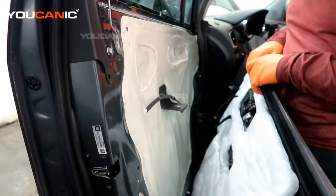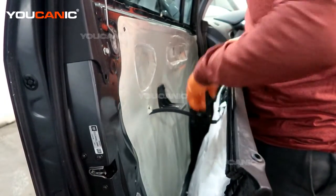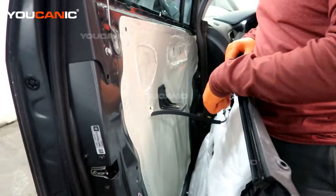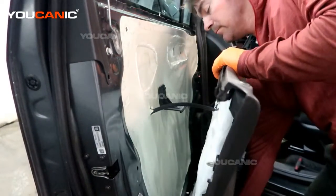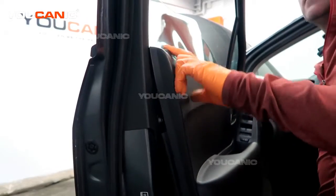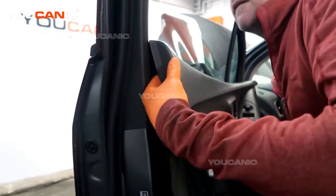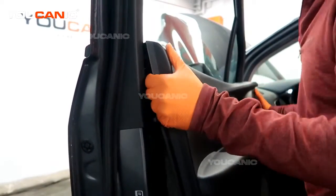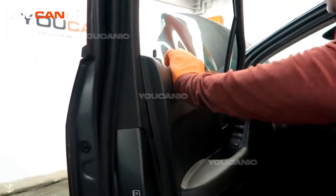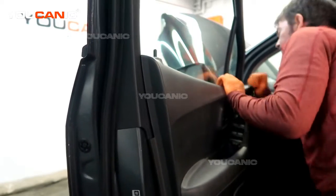Then we have our cable here for the door lock to open. You just push it into the slot there, pull it back, then push it this way to get the lock on. Now you'll need to raise it up and make sure you line the door lock button over it, put some angle on it, and kind of angle it out a little to be able to get this to press down into the window frame.